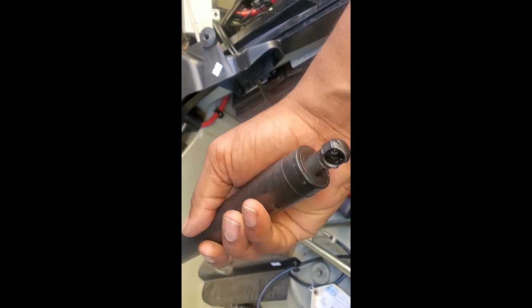Spring side faces in. The plastic shield cover faces out of the trunk. So very simple to install. These have spring clips on them. So all you have to do is press them onto these ball sockets in the back. You can see right there, there's a ball socket back there. There's one on each side of the trunk. There's one right there, and then the other ones are behind this bracket and behind this bracket, which is actually the bracket for the trunk, which attaches to that. So that's how the trunk goes up and down.